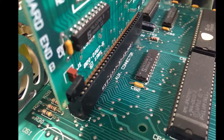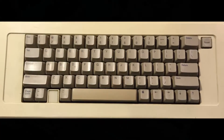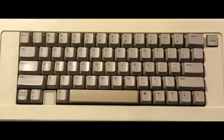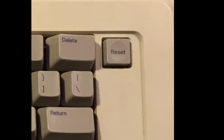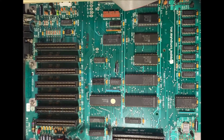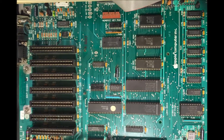The Aux slot was a huge improvement, allowing an easy upgrade to 80-column text and double high-resolution graphics. Improved character and keyboard functionality included lowercase letters, cursor control and editing keys, plus the now-famous open and solid Apple keys. The reset key was moved to avoid accidents, and auto-repeat was now a standard feature. Apple also lowered the production cost, reduced the design complexity, and improved the reliability of the machine through chip count reduction and better case design.